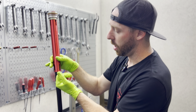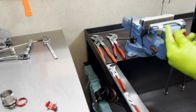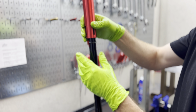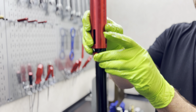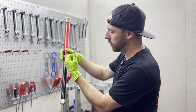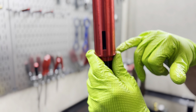Next let's shift focus to sealing this tube off from any oil entering — here's how we're going to do that. We've got these two half-moon washers with a nice o-ring groove on the inside. I'm going to line up this groove right with the o-ring, then grab the other one and fit that right there. Beautiful — that's going to slide up into here. What that does is create a nice seal so no oil is going to go in here. Any oil that comes in the top will exit outside of these vent holes right here, and any oil that collects will pull out — it can't collect and pool up in there.